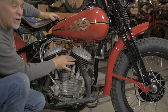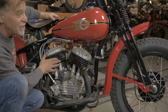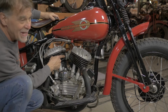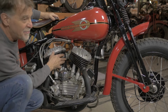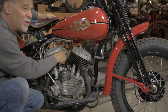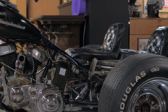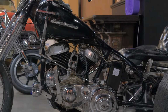Moving down, the cylinders, 1938, they don't have as many fins as the racing bikes in 39, and that's standard. But what isn't standard is right here. This particular set of cylinders has 1 9/16" intake manifold nuts. That's the same as a big twin Knucklehead, a WR. It also has the bronze intake manifold and a 4-bolt carburetor. Now, I've only seen this combination on a few bikes. One of those bikes happens to be my first Harley 45, my 3-wheel chopper, small fins, as the guys say, small fins, big port, makes this bike run really good.